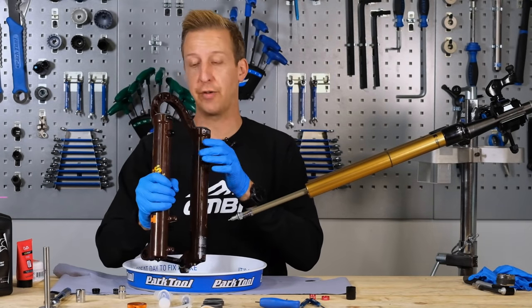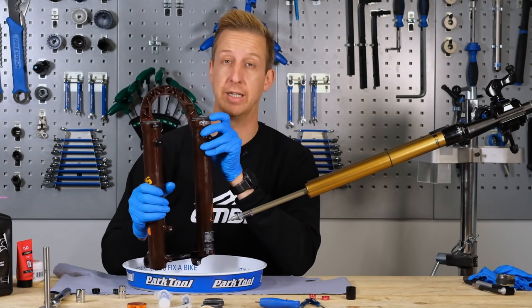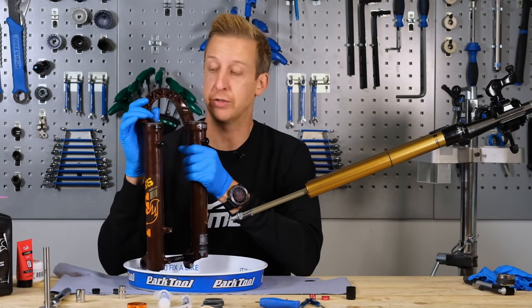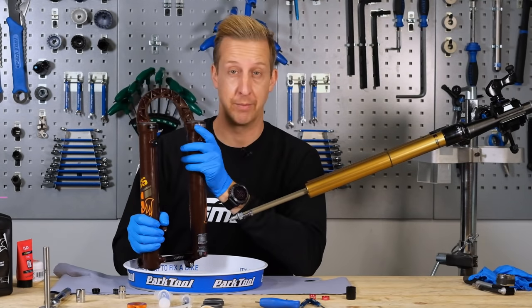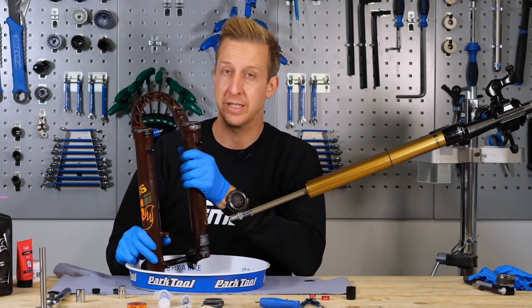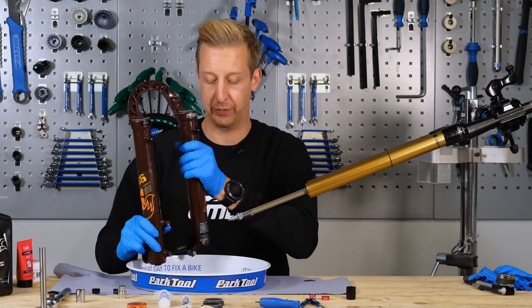For cleaning the inside, make sure you clean around the seals and inspect them for damage — look for any splits or signs of perishing. If a seal is damaged, you'll need to replace it. As far as removing seals goes, you can use a ring spanner, but when it comes to reseating them it can be a problem without the specific setting tool, which is expensive. If your seals need replacing, I recommend finding someone with the correct tool, though I know people who have bashed them in with a mallet and a bit of grease.